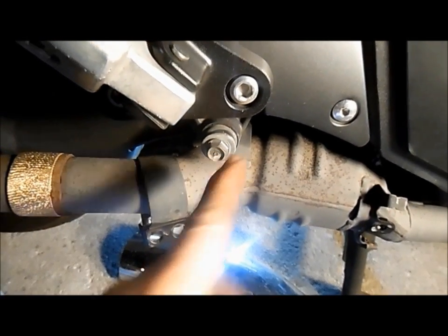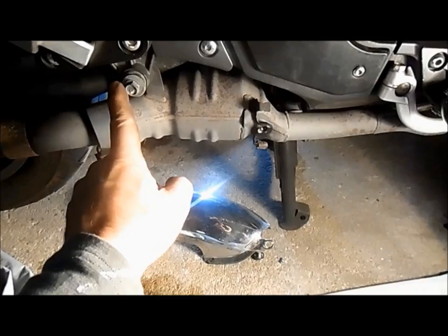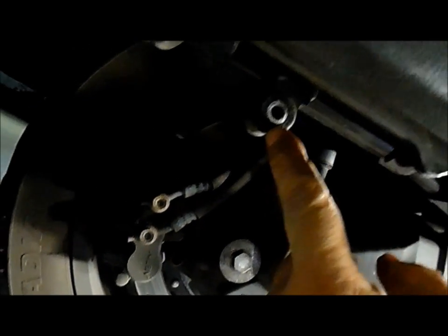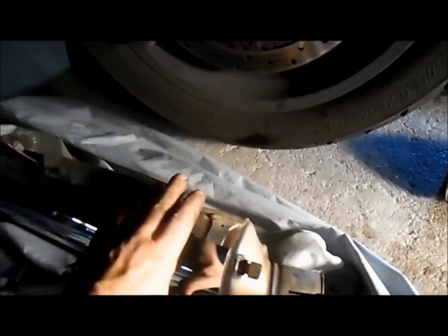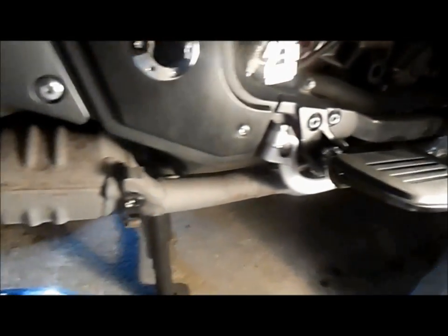On this one, this is the 12mm that I actually didn't take out — I just backed it out to make it easier, because I had to remove the muffler. There's another 12mm right here to remove the muffler. The easiest way, once you remove that bolt, is to just twist it back and forth and it'll pop out with no problem — I didn't have any difficulty whatsoever. We're working our way down to just the pipes.